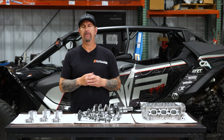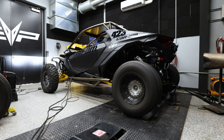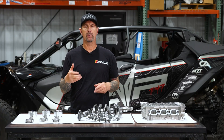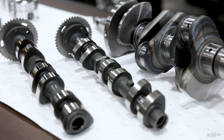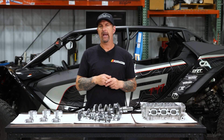Like we described in the video we released a few months ago, it has an amazing performance gain, especially from low RPM. It's like driving a two-liter car or a supercharged car on the bottom end, even with a big turbo — just an amazing upgrade. All of those tests were done with a stock head, so all the gains were stock head with just our stage one camshaft package.